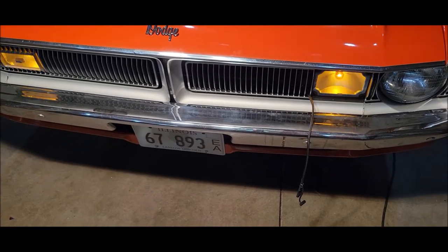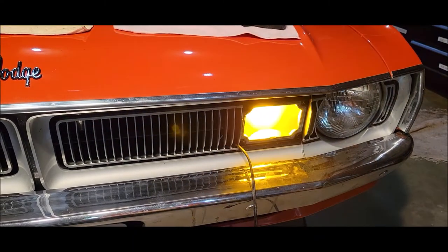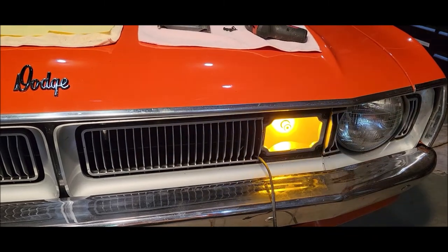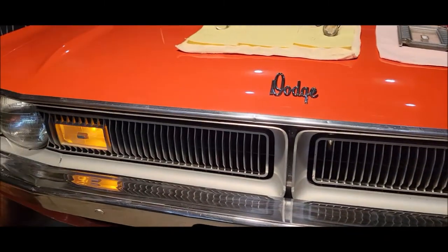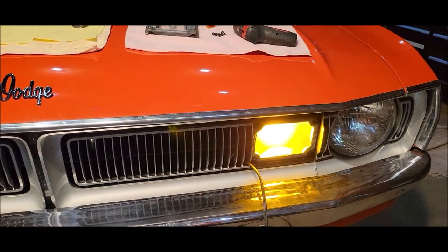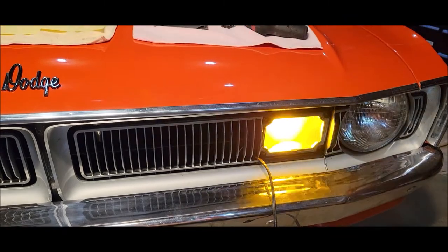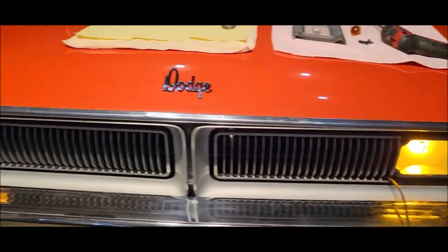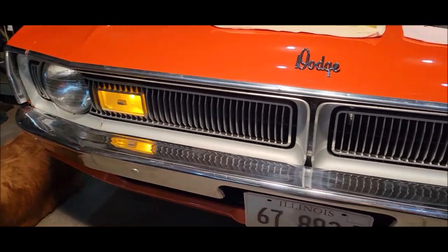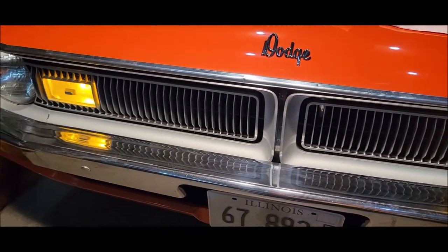But let's try an LED in the front. I guess I didn't keep very good records. The four-ways work fine — again, LEDs on both sides in the rear, and for testing, an LED on one side and a regular on the other. The four-ways work fine with the number two flasher.